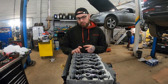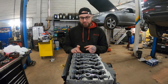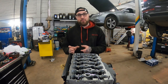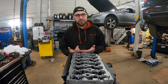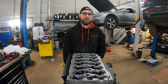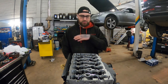Basically I think it's just due to them being long and after 100,000 miles with the heat and everything they just distort. He said the chances are, because of the valve guide tube it runs through, when the spring pulls it up it probably seats anyway - so it's not necessarily anything wrong. But obviously with what I'm doing he said he doesn't recommend leaving them distorted, and I agreed straight away - I'm not using them.